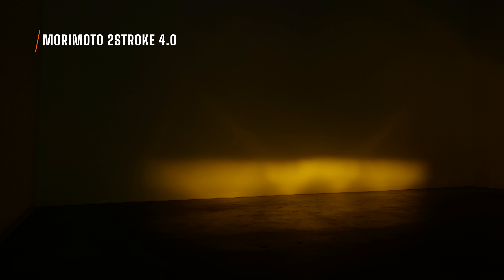This is what the yellow Two-Stroke 4.0 looks like in an H11 reflector housing. In testing, I measured 400 maximum lux at startup from the yellow bulb, and after 15 minutes we measured 380 max lux — so they don't lose a lot of light. But the yellow light output is never as bright as bright white. A lot of people don't use yellow in a headlight housing — they use it to replace their halogen bulb in a fog light housing. If it's snowing or foggy outside, that is a much better upgrade than putting these in a headlight.